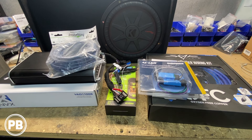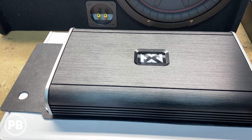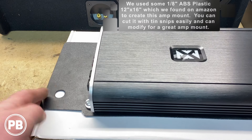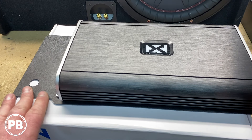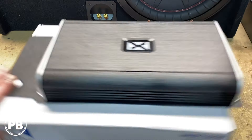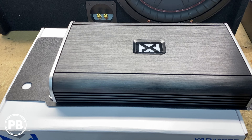We'll link everything in the description. What we need to do now is start planning our power and ground and where we're going to mount our amplifier, then turn our attention to signal and speaker output. We've decided to mount the amp underneath the back seat — it's skinny enough to sit in the factory cubby. We built a platform so it sits nicely there and snagged one of the seat bolts to hold it in place. This side has power, ground, remote turn-on, and speaker wire outputs; the other side has signal input from the line-out converter and controls. Let's head to the truck, pop the hood, and start planning our wire route from the battery through the firewall to the rear seat.